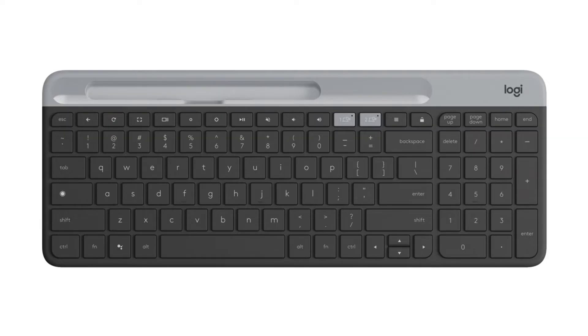This problem can be solved by turning number lock on this particular keyboard, which sounds easy enough, except there is no clear number lock key on the Chrome OS Edition of the K580 keyboard.